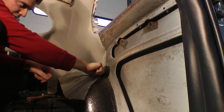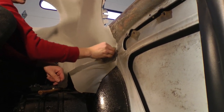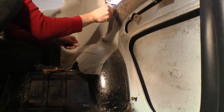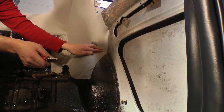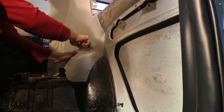You glue inside where the door panel would sit, just with your thumb - that's what you glue in there, because the door panel will hide it and you won't see it. I just want to get this a little tighter down here on the wheel hump. Now you can cut the excess off if you'd like - you don't have to, the carpet will cover it, but I usually like to cut the excess off.